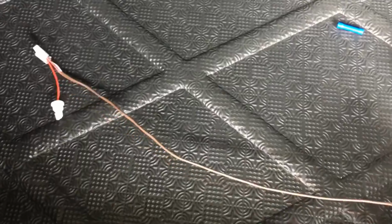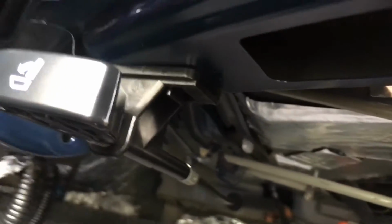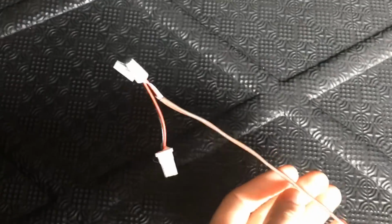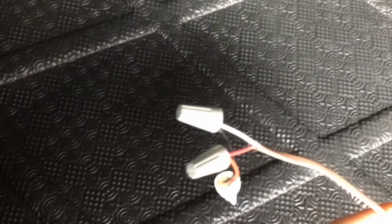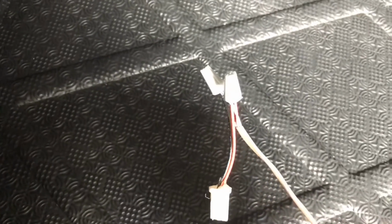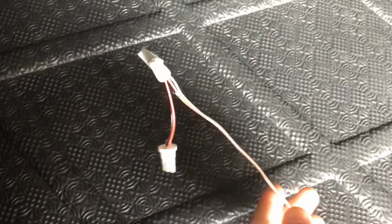So also, you might see this big strand and wonder what it's for. This light is going to stretch the whole way across, but the plug is in the middle. So I have to have a piece that goes across. I'm going to wrap it around this back seat release here, and then the light will be able to go the whole way across. And this is 18 gauge wire. I picked it up from Lowe's. I got a 50-foot roll, I think, for $12. And these are gray wire caps, a little bright, but they are mainly for 18 to 22 gauge.